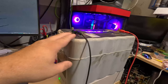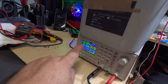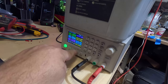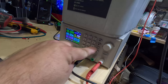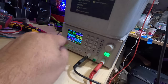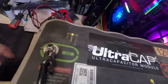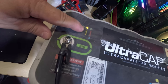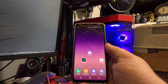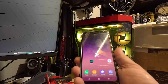I've got the supercap hooked up to my bench power supply right now. The power supply is not on, and we can see the supercap is not putting out any power whatsoever. So let's set this for 14.4 volts at 12 amps, which is the max my power supply can do, and let's turn it on. It immediately goes to 14 volts. We can look on top and see there's a maintenance light on. Let's get the Bluetooth app up and running. Unfortunately I couldn't use my S20 because the app is too old — it won't run on Android 12. This is an old S8, running Android 9.